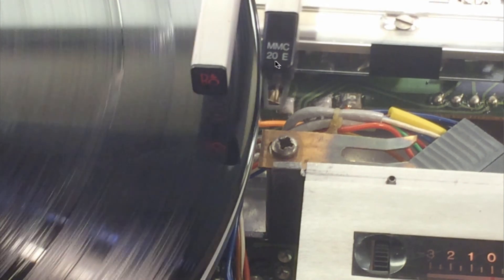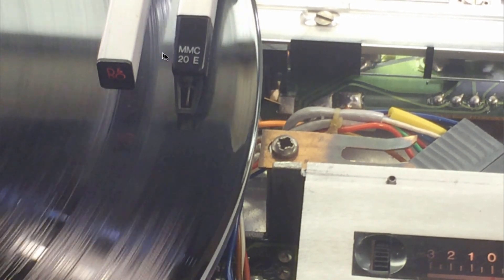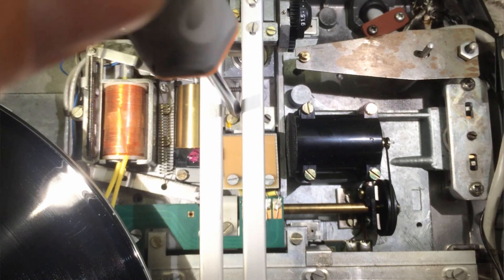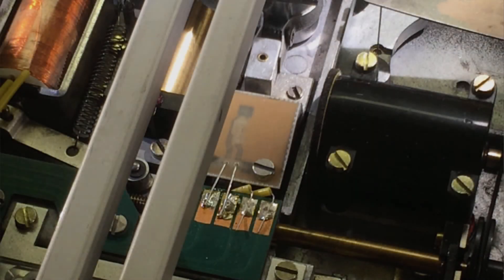What we see here is after the tone arm goes down, the carriage continues moving, and after it stops you can see the angle is a little bit too large. These two arms should be nearly parallel, or the angle should be a little bit towards the center of the record while it is running. The adjustment process starts by loosening the locking screw a little bit, which enables use of the excenter to move the assembly back and forth. In this case, with the too-sensitive tracking mechanism, the excenter needs to be turned a little bit clockwise. If the angle were too small — meaning the tracking mechanism is too reluctant to follow the needle towards the center of the record — then we would turn it counterclockwise.